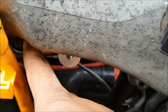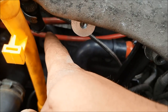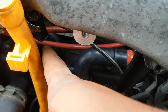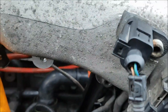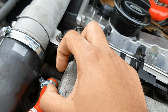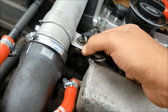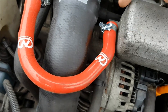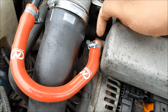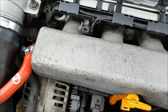When you take it off this will come off as well — just cut the L-piece and stick a screw in it and secure it back on. We'll be plugging up the nipple on the inlet manifold in the middle and underneath. My L-piece broke so I ended up putting the screw in on the straight part coming off and secured it with a jubilee clamp. The piping runs underneath and connects to the brake servo via a funny little S-pipe. You'll already have one of these pipes in your factory system and you can plug it directly into the nipple coming off the end of the inlet manifold for your brake booster. While I was there I decided to change it for a Creations Motorsport red silicone one.